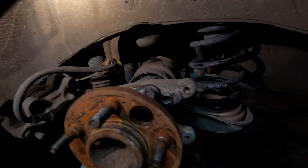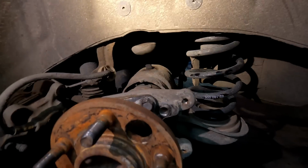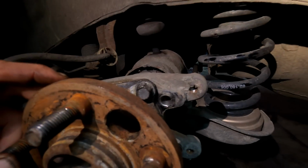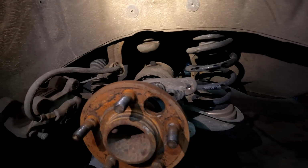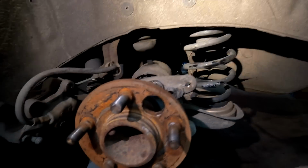All right, guys, so I got the back dust shields off, and I reinstalled my axles with this little plate here, so it's just the four bolts. Make sure they're nice and tight. So we're gonna wanna keep removing our factory e-brake system, so we're gonna have to head to the interior now, and we're gonna actually take out the whole factory e-brake box.